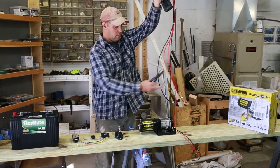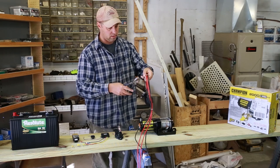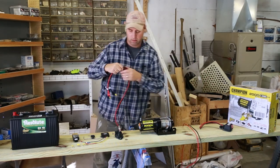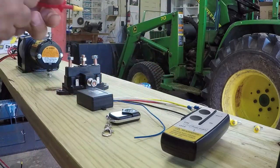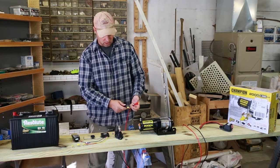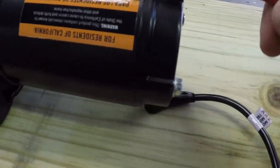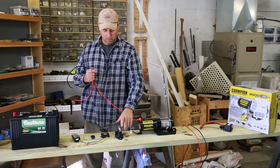What I'm gonna do is just cut these wires off and recycle them and use them for wiring in our new system. I'll save a little tail on this in case I ever want to use this switch for anything else. I've got plenty of wires there, so just snip these off. I'm just gonna take the two labeled that go to the winch already — labeled minus, plus, to winch motor — so make it easy. In this winch here it does say plus or minus, so we'll go ahead and just put them on the way it says. Alright, so we got positive and negative hooked on to the winch.